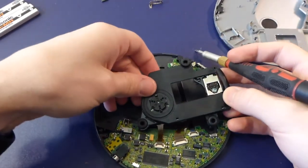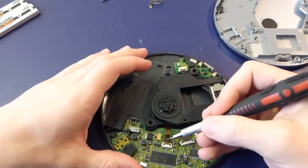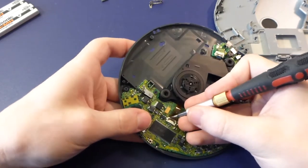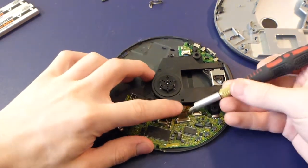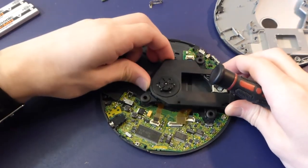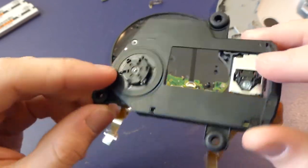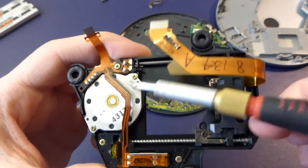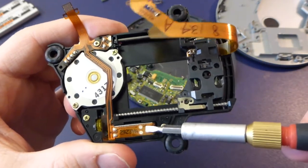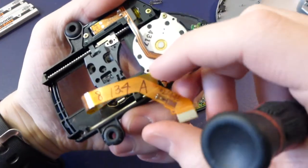Let's just lift that up. We've got two flat flexes — this one is probably for the motor drive and this one is definitely the data output from the laser. Those are some really stiff flat flex connector tabs, much more robust than I would have expected, but in an active product that's a good thing. Here we go — we've got the laser assembly on the carriage, then our motor. Underneath there's a very thin pancake motor. There's also a longer motor here which drives this worm shaft, which is what the laser carriage uses to travel back and forth.